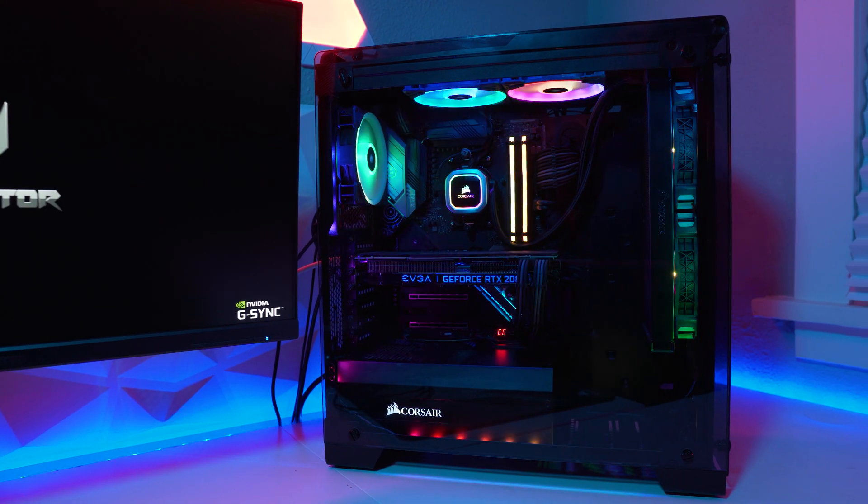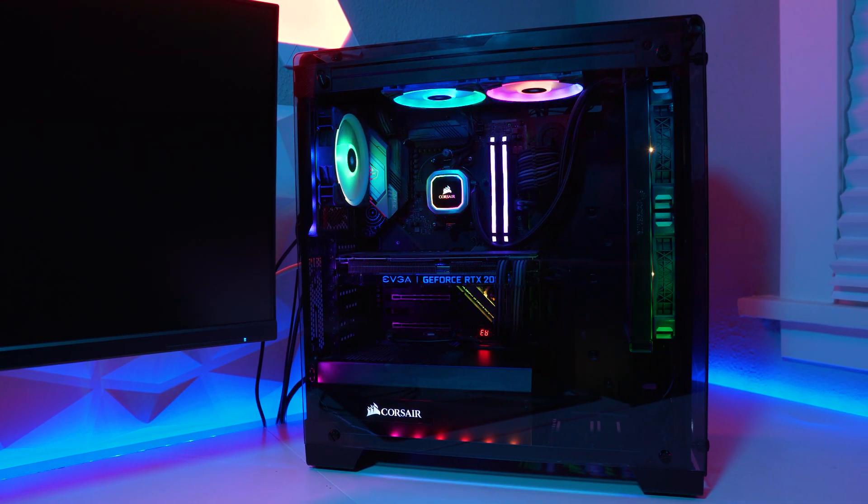That's really it — those are the quick steps to clean your PC. If you keep your PC on the floor or on carpet, I highly recommend you don't do that, as it causes a lot more dust buildup. Try to clean your computer every six months or so in that case. But if your computer sits on your desk like mine does, yearly intervals should be just fine — you're not going to pick up nearly as much dust.